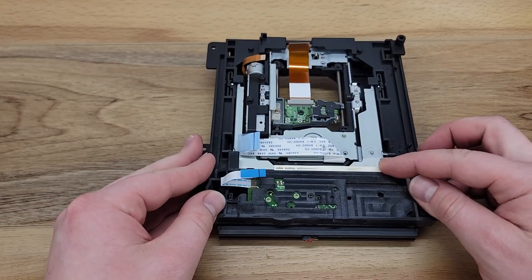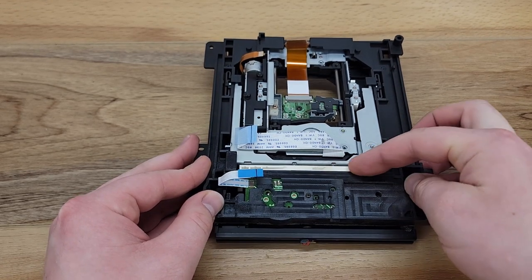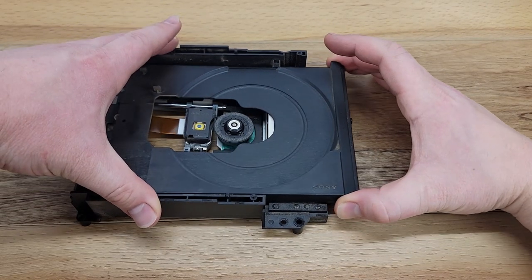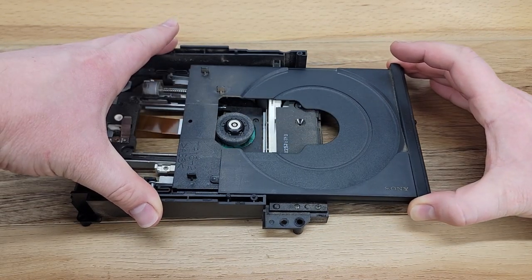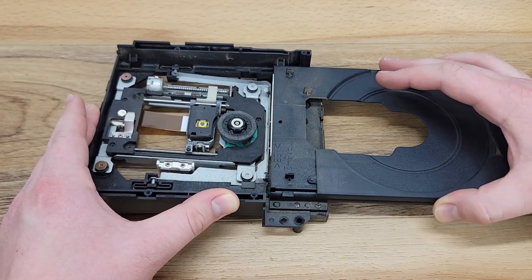Flipping the disk drive over, you can lower the laser carrier by moving this white lever. This will need to be done so the disk drawer itself can be removed without making contact with the laser. I'll have a separate video on my channel where we completely remove the disk drawer and replace the belt.